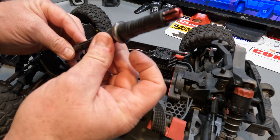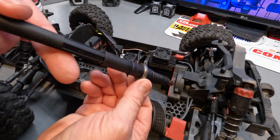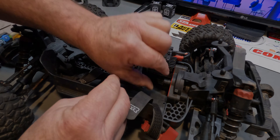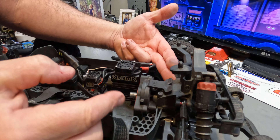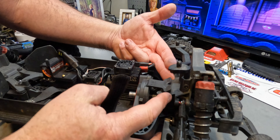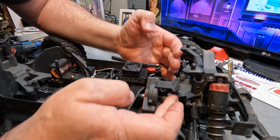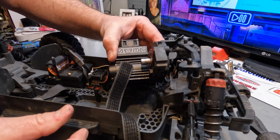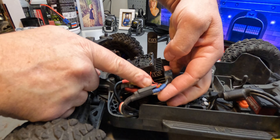Checking the bearing again — I already know the bearing is fine, but I may put a little grease on here. Don't lose your parts. Normally I put the vehicle kind of against me, lift up on the tab — it's got two pull things — wiggle it back and forth, and once you get this tab past a certain point it will retain itself and slide out. I'm going to disconnect these wires.